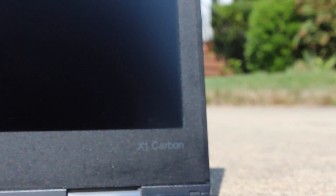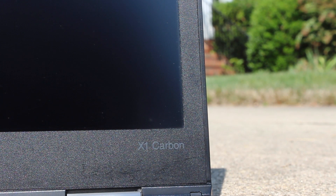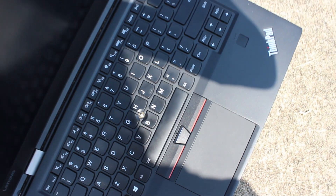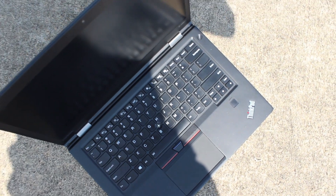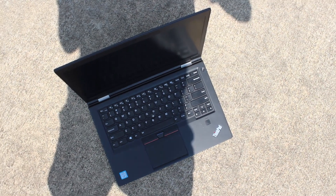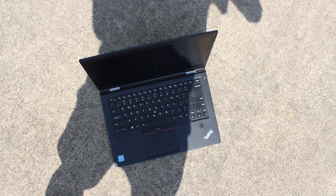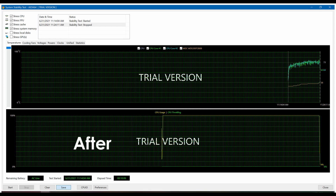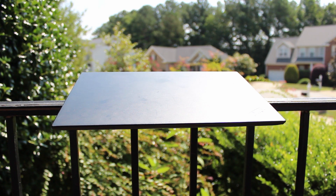And that's how you can upgrade the X1 Carbon 4th Generation Ultrabook. In my opinion, all the upgrades are worth doing. More storage space is always a good thing, especially because larger SSDs last longer. Replacing the battery can extend the laptop's runtime by a lot, especially if the old one was worn from use. The thermal paste replacement is also well worth it. After the repaste, my machine's CPU temperatures were lower overall, and it took a longer time to peak in a 10-minute stress test. Lower internal temperatures can improve comfort, performance, and longevity on these laptops, so they're always welcome.